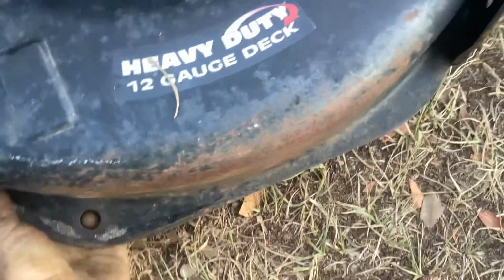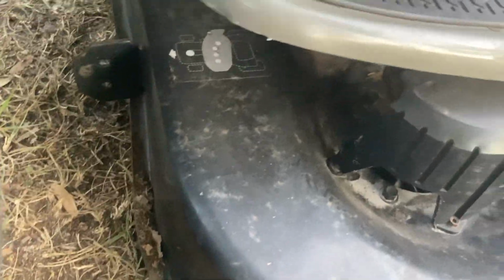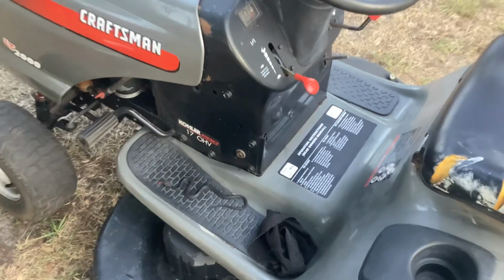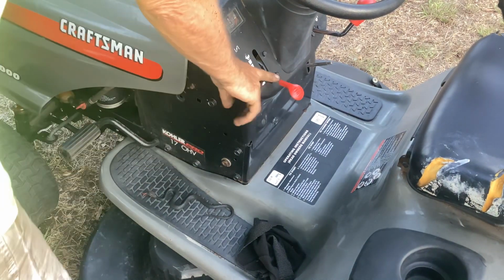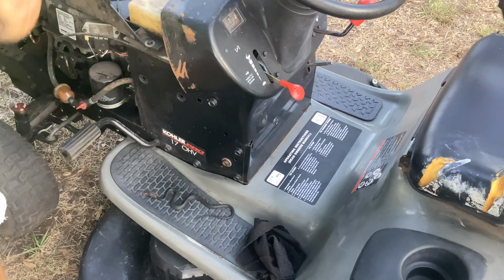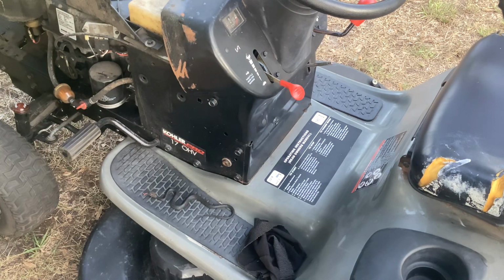Yeah, that blade's moving. I thought that didn't look too bad. I could deal with the blown out tire. I thought $100. So it seemed to be so far so good. I'm going to adjust the idle. It seemed to have too much of a high idle down at low. I'm going to adjust that. Bring the RPMs down just a little bit more. So premium maintenance package, Kohler, Pro, Craftsman, overhead valve, hydraulic valve lifters, large oil, air, and fuel filters, cast iron cylinder liner.